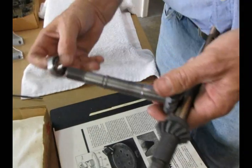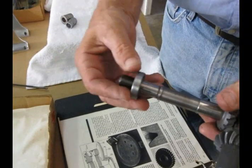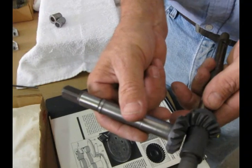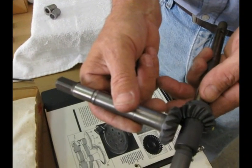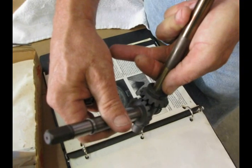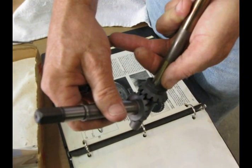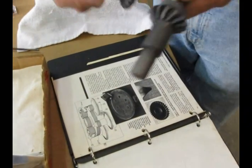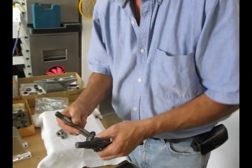This bearing was holding the thrust against it and it simply would not do it. That bearing would fail — the gears would come out of phase, the backlash would be too great. Your load transfer would come away from the root of the tooth of the gear and you'd wind up breaking the gear off. After that, the failure was catastrophic and instant.